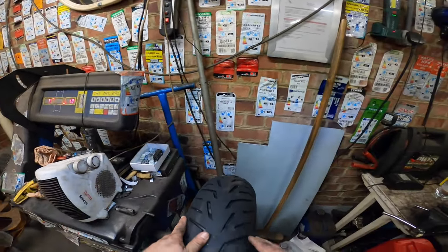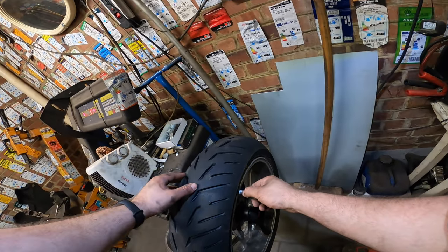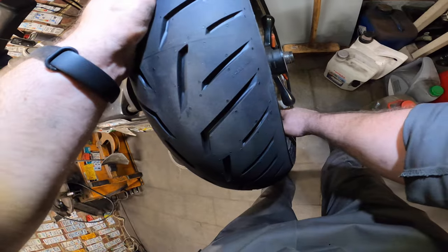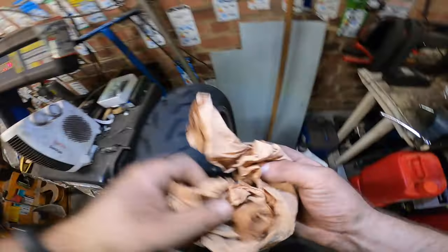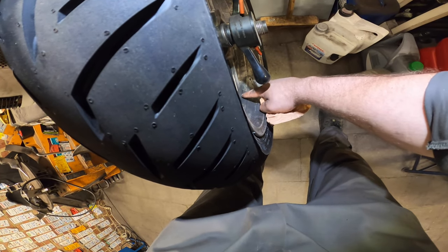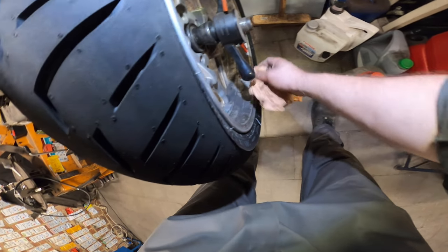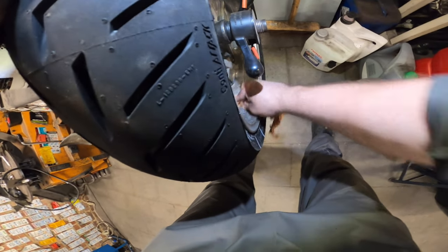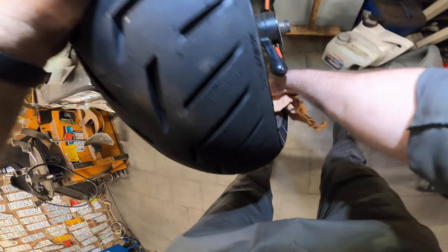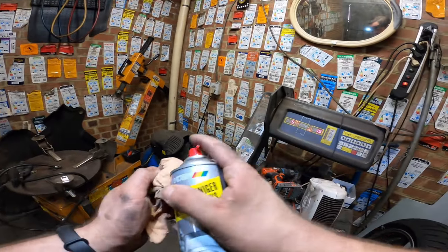Another 10 grams on the same spot, I suppose. Yeah, nearly on the same spot, so a little bit more over here. Let's put on an extra 10. It says over here, that's right between those fake spokes, and it will be difficult to put it over here. You could stick them over here as well, of course. There was one on there over here, as you can see, but it fell off or was taken off, could be the case as well.